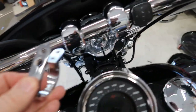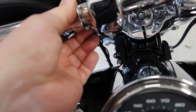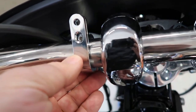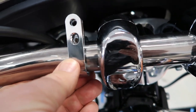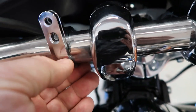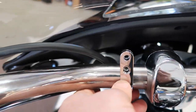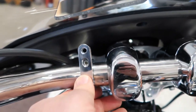What I've done is go out and spend approximately 10 bucks to get a different mount, which is fine because I have chrome bars anyway and I prefer not to have the black. Here's the other piece I purchased. It fits on there, and it's got a little bit of slop — that's why they give you a clear plastic rubber piece that fits in there so it'll grip right on. Makes a nice contact point. We have the ability on the Sport Glide to pop the fairing off quite easily, so for mounting this I'll pop that fairing off and we'll be in good shape.